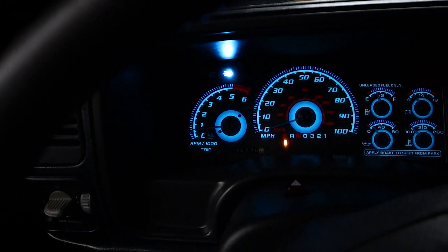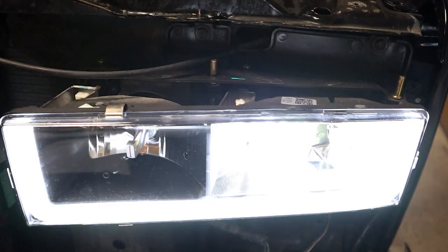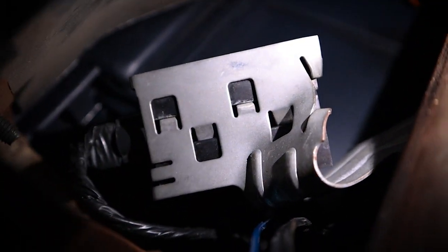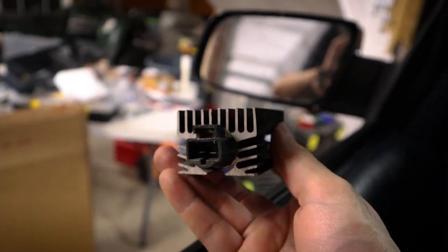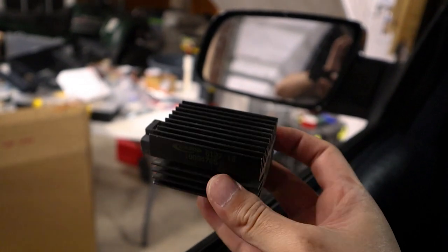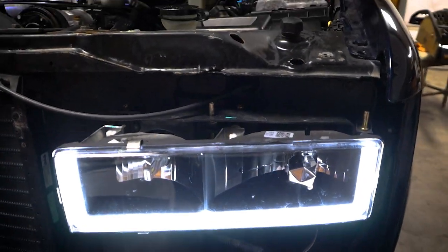The next thing is — even without the headlamps on, you can see the projectors are on. Let me show you what to do to get this feature turned off. If you go underneath your dash at about this point, you'll see a module. It's pretty tight down there, but you don't necessarily need to pull it out — all you need to do is unplug it. On top of it there's a little lever; you push that down, wiggle it out, and that's essentially all you have to do. Press it on the top and it comes out. That is how you get rid of your factory DRLs, and now this looks a lot better.